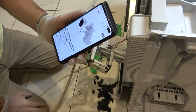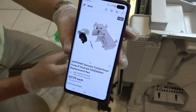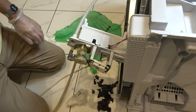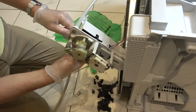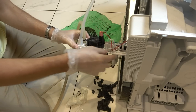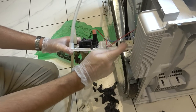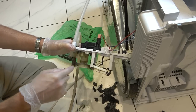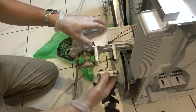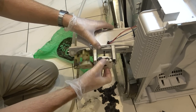I typed it into Google - just the Hotpoint Aquarius and the model number - and I put in 'pump'. It says 'pump and float kit'. That's what this part is. This bottom bit here is the float and this bit here must be the pump. So the pump is at its lowest point and the float tells the pump to kick in or not. Here is the little micro switch - it's this bit here with the blue wires. The red wires go off to the actual pump itself. 100% this is the problem. It can come out. I'm going to clean that under the tap.